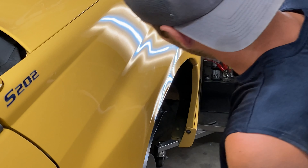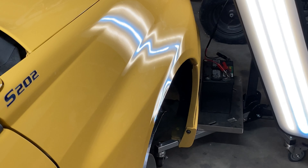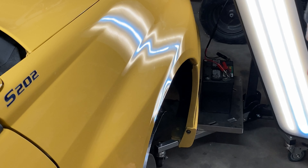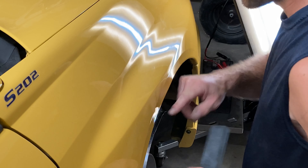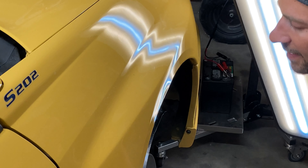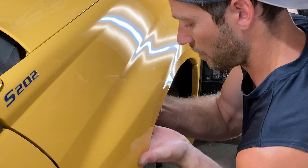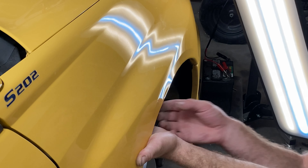I'm gonna talk for a second about how to approach getting this thing back in. You might say, why don't you just put your hammer there and use this like a dolly? That's just gonna put a bunch of little puncture marks in the paint. So you need to use something soft here, like a rubber block. I'm basically gonna have the rubber block go right here, and it's gonna stop right there where it's most indented. I can't just hammer this back in — that's not gonna work, it'll bow this part in further.